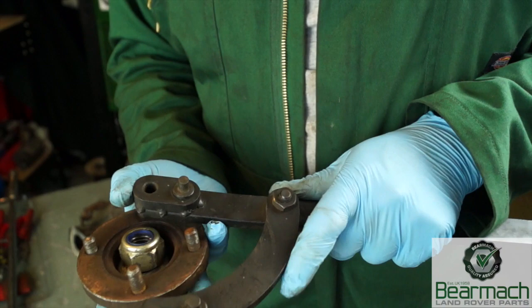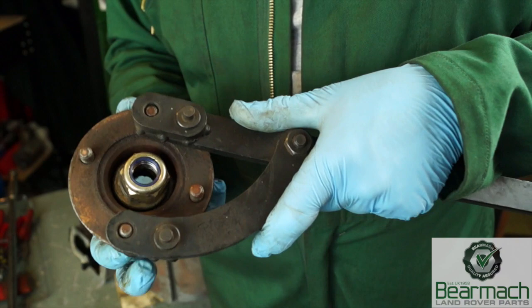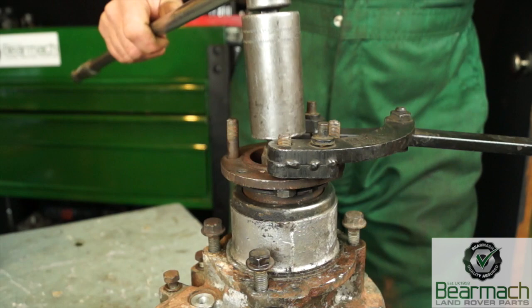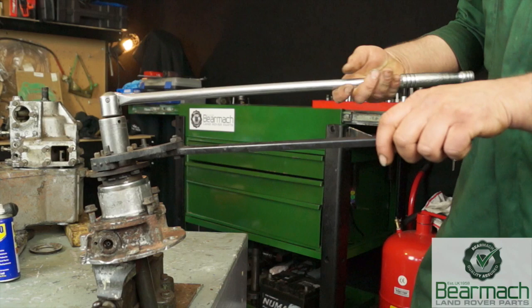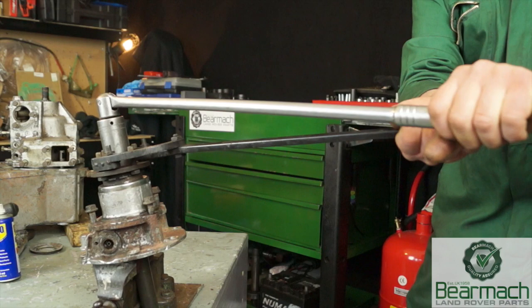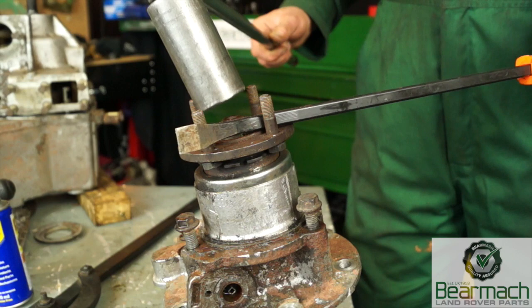This is the correct tool for holding the flange when you're removing a nut. Basically what it does is hold the studs in place while you crank it — you can see that here. It's a specialist tool and it's very expensive. It is possible to make a tool like this if you have the welding or fabrication skills. You need to hold the flange while you undo the nut otherwise it will just spin. I've got it lightly clamped in the vise just to hold it, and it has enough length on both tools to tighten the nut to the correct torque.